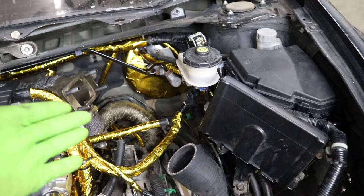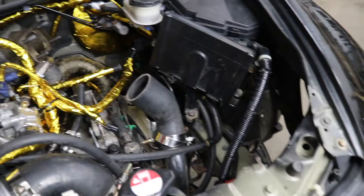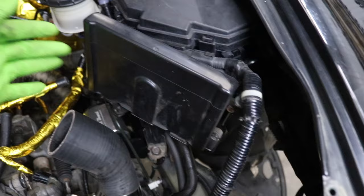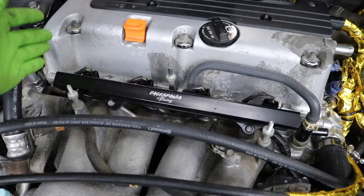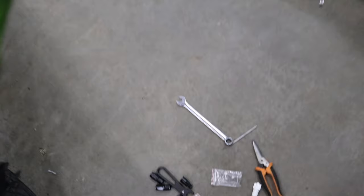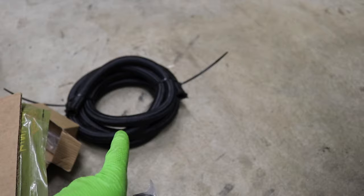We're not running a return system because this is a budget build. We're going to run a line from the factory fuel line — same routing as where our brake booster line and EVAP line went — coming up to our fuel rail over here, and then we're just going to put a block-off cap on the other side. So it's a returnless system still running off the stock regulator in the tank. We're going to slap a 340 liter per hour DW fuel pump in it. Jack Spania Racing sent us out some AN fittings — we got a whole bunch of them, and we got a whole bunch of 10 AN line too, which we're going to be building for our oil drain off the turbo and that timing cover piece.